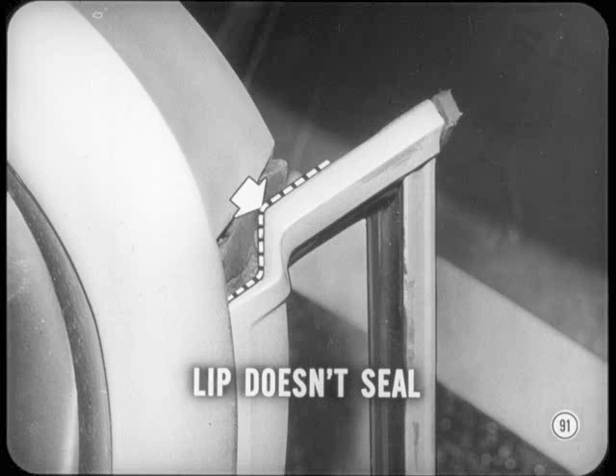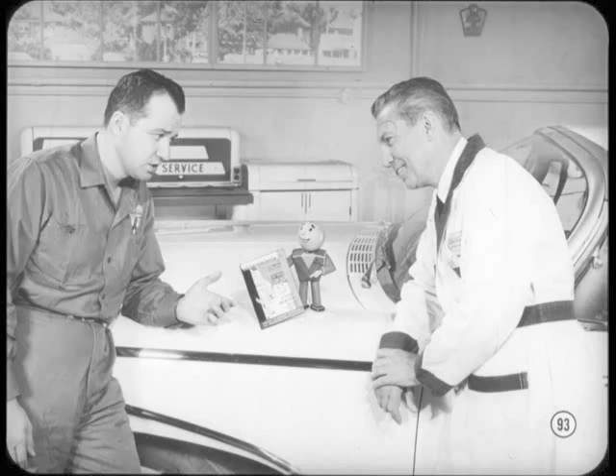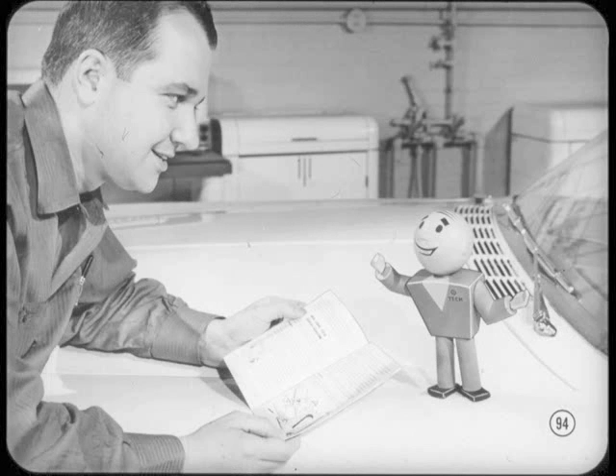You can inspect for a possible leak at the vent wing seal from the inside. Latch the top down securely, close the door, and see if you can see a pinhole of light at the upper edge of the vent glass. If you spot an opening, check from the outside of the car. If there is a leak, you'll probably find that the sealing lip doesn't seal along the top edge of the vent. You may have to trim off the top of the seal so you can move it up enough to get a good sealing lip fit, or install a new seal entirely. This reference book has the whole story — practice what we've covered, and you'll find most Suburban and convertible body jobs a lot easier.